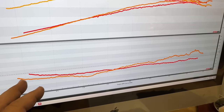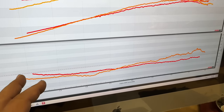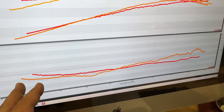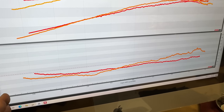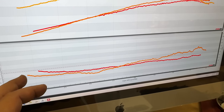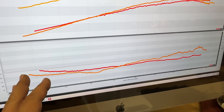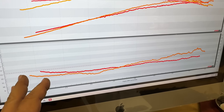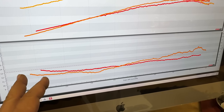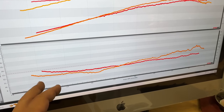Carburetors need airflow in order to work. I had to increase the idle speed, which also in turn turns the distributor faster, which increases timing in order to stop the engine from pinging. And I think if the venturis on the carburetors were smaller, we would have more airflow and we wouldn't have the problem of needing to increase the engine RPM to a higher than normal amount in order to start getting enough air to lift those pistons up and allow the fuel in.